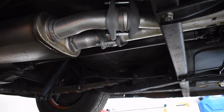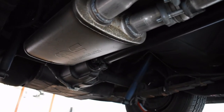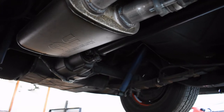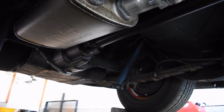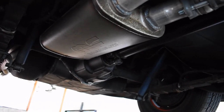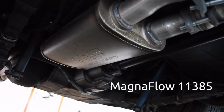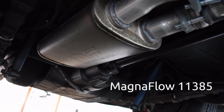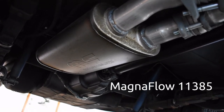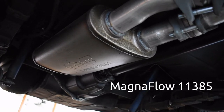They enter this dual exhaust Magnaflow muffler that we've installed. You can see it pivots on an angle so that it can avoid hitting the diff as it heads back. It's a pretty compact muffler — not one of those long skinny ones, it's stubbier and more rectangular. It has a very nice sound; I really like it. It's also an X-pipe inside — like an X-pipe and muffler combined into one unit. I'll post the part number on the website. That's probably the best decision we ever made, and it doesn't take up very much room under here.